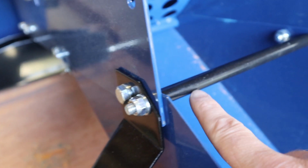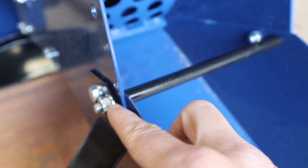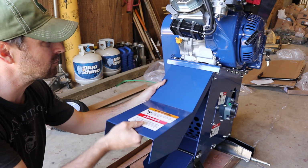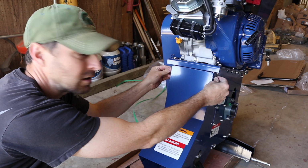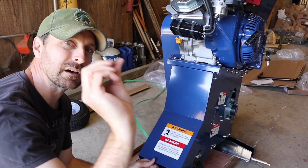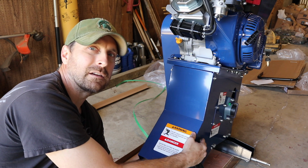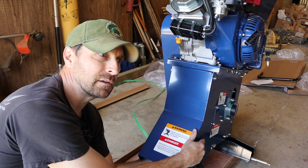So this is how I've attached it and put it on. This spacer here is to keep everything from compressing as you tighten it on. Then the chute comes down through the middle of the front leg. From there we can put our front chute cover on, and that kind of just threads through up here at the top underneath this lip, and it hangs on these 2 little bolts here that are actually welded into the sides. They've got nuts on them. And then on the side down here, you've got another 13 mil, and you're going to have to get your hand up under and in here to actually put it on, but that's no big deal. So right here on the side, it's plenty of room to get your hand up in there and feel around and get that bolt on.